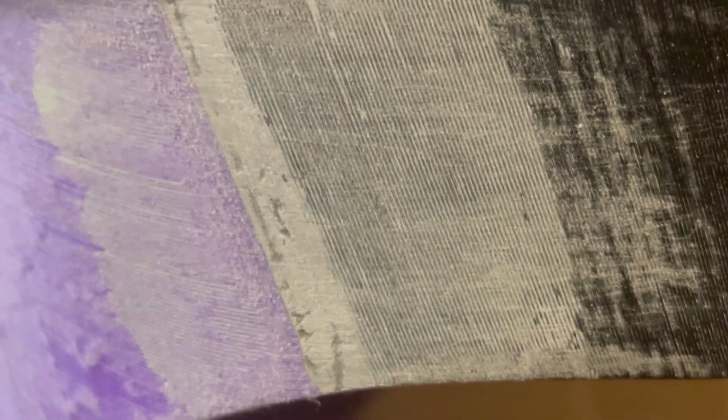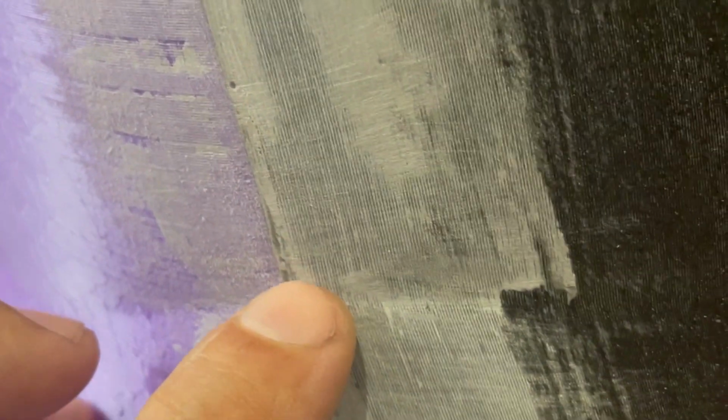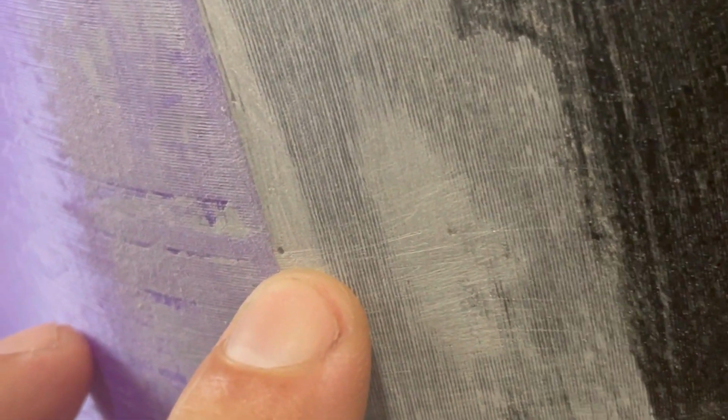Could you put plastic metal back over this? Absolutely. So if you don't want to chance it, I guess. However, in this crevice especially, you can see how small it is just with the tip of my finger. This right here, it would be very hard to get this so smoothed out. So you're really better off putting some actual body filler in here and just sanding it very lightly. It'll reform this whole line. It'll come out perfect. So these are the type of openings that are absolutely perfect for body filler, okay?